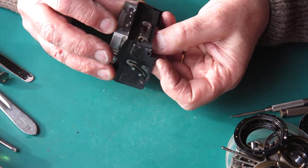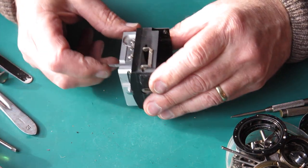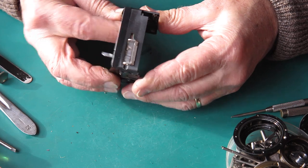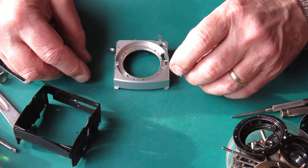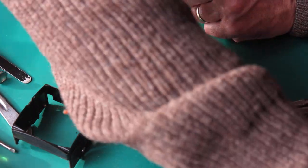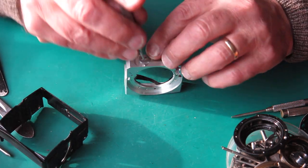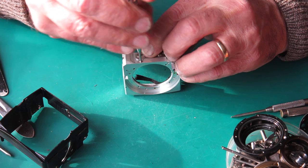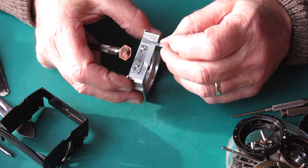This is the shutter release piece — checking that it's not loose — no, it's good. Pressing the buttons and pushing through should bring it out. We have our two return springs for the buttons and our two buttons. Here's the front standard — I'll remove its return spring and two screws. That's quite stiff — it doesn't return to the up position easily by itself.